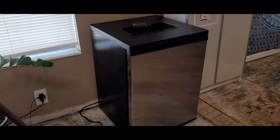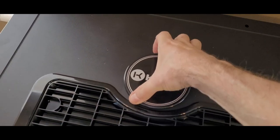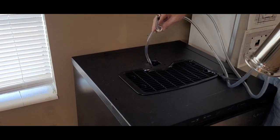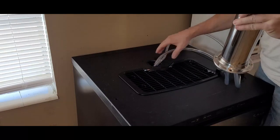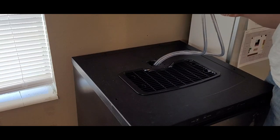The fridge arrived and it was time to start the build. Normally you'd start by drilling an inch and a half hole through the top of the fridge, but this one came pre-drilled. Next, you'd pre-drill for the tower mounting holes, but again, these are already here. With your mounting holes drilled, you can feed the beer lines from the tower into the fridge. If you've cut your own hole, you may want to ease the edges or insert a PVC sleeve so you don't damage the lines.